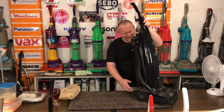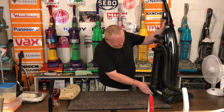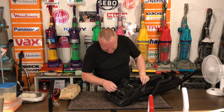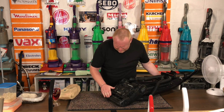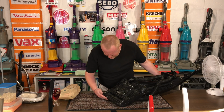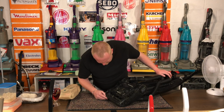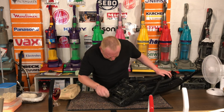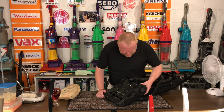So if you move around to the back, he has got all his tools, his hose. The button is broken because the damage is underneath here. This still works. Let me see, does the brush bar spin? Yeah, there's plenty of bristles left on the brush roll. That is in good condition. The belt does seem a little bit slippy, but I can't get his release mechanism to work.